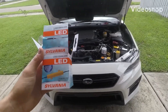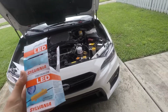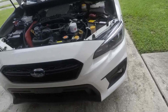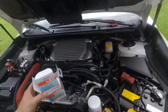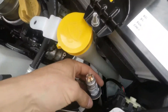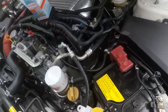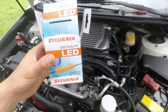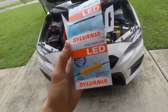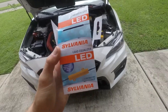Welcome back. I'm gonna make a pretty short video. I cannot stand orange in my headlights, so I replaced the blinker bulbs — the amber blinker bulbs — with LED bulbs, and I'm just gonna do a really quick tutorial on a load equalizer for the LED lights so you can get rid of any hyper flash issues you may be having.